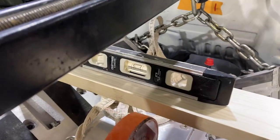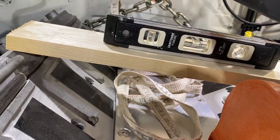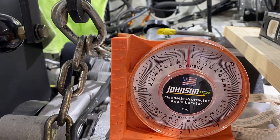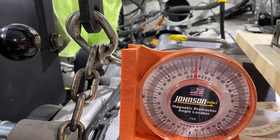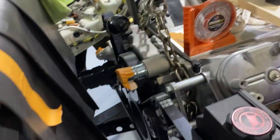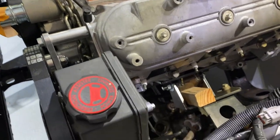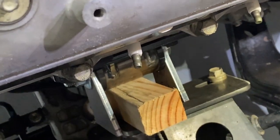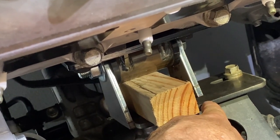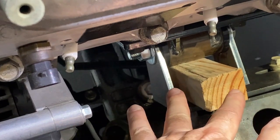I've got the motor set down in here. Looking at the alignment from side to side, it appears the bubble is right in the middle as far as left to right. The angle, based on the valley cover, looks like about four and a half degrees or so — I prefer closer to four, but once we put the transmission on there's some movement within the mounts and the settling of the full weight, so I expect to get that half degree. I've got the distance between the top of the tab and the end within 0.05 millimeters on both sides, and on the front it's lining up with my mark — perfect position.